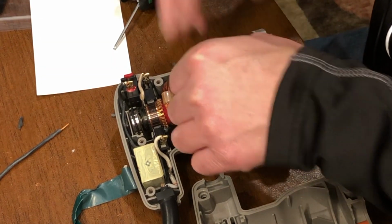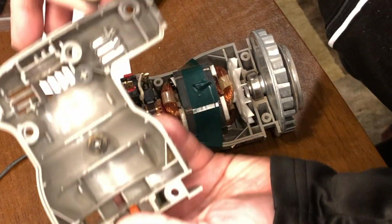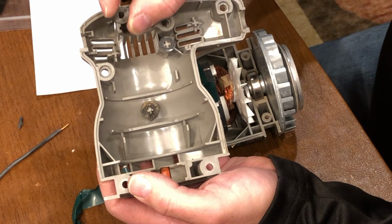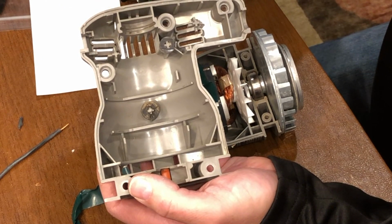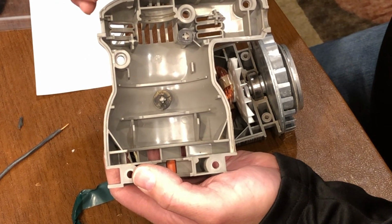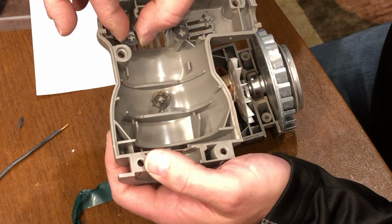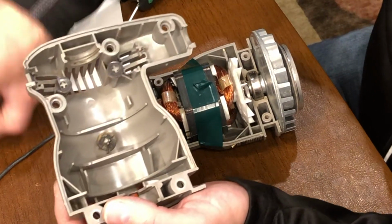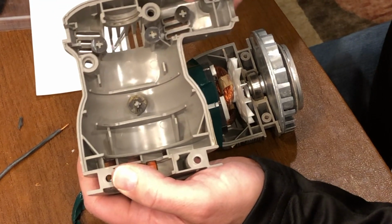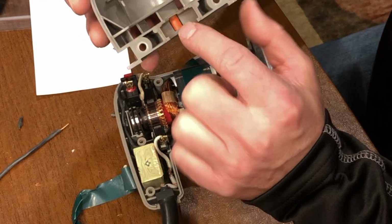Remove some of the tape. When I look at the other half of the housing, the shell, yeah, good, it's coming through on the camera, you'll see that I need to replace or put back these little rubber pads. They go on every point where there's sort of this cross member. And fortunately, I know which way they go because the indent helps me track it down. There's 1, 2, 3 points of contact, plus one that goes on top of the motor.